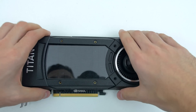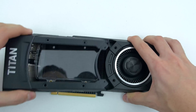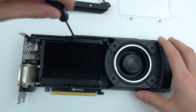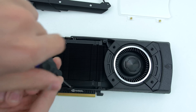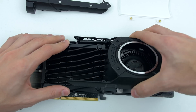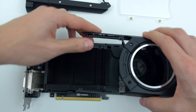Once those are all out you are ready to slide out the piece with the word Titan on it. Gently raise it and slide it away from the fan until it pops out completely. Before we can remove the other piece there are four tiny screws that need to be removed first — that's where the tiny head screwdriver comes in. Once all four screws are removed, gently raise the final piece until it comes off, but be careful not to pull it out completely.